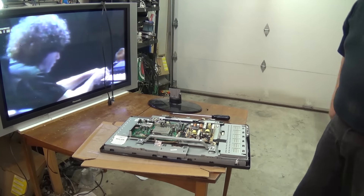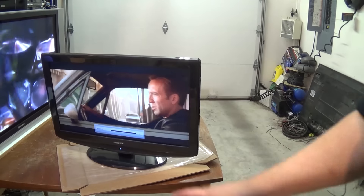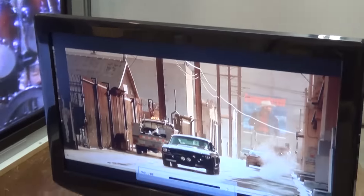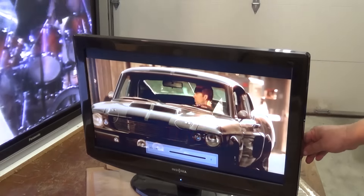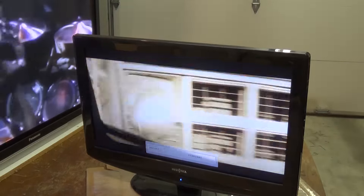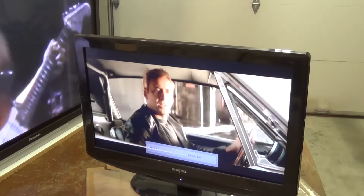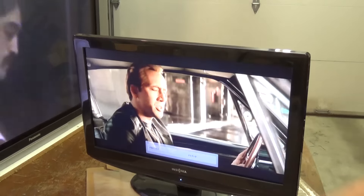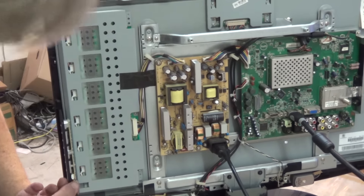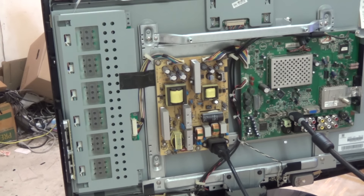We can determine if it's a switch failure by unplugging the switches and seeing if our fault goes away. We have our volume stuck down — if I press any of the buttons here it's going to start cycling. So I'm going to unplug the control cable that goes through the switches. That will rule out whether it's a problem on the switch panel itself. Unplugging them should stop this from doing it. This is the cable here — it plugs into the switches — so I'm just going to unplug it right from here and we'll see if it stops the problem.